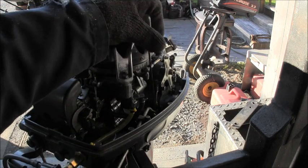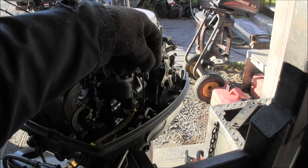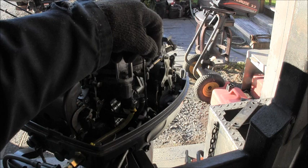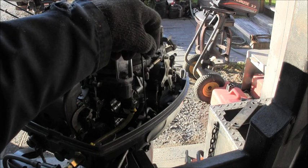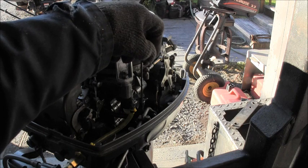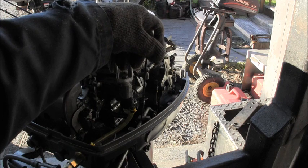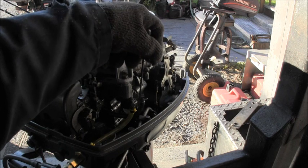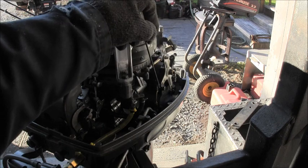And this would be easy to make out of just drilling a hole in the bottom of the pan and putting like a piece of copper pipe spacer or an aluminum spacer or even stacked nuts. And then you could easily make this out of a piece of cutting board, that white cutting board material. You could easily drill a hole and then saw through it. That would be easy to make. Then it comes down here and it just bends at a 90, has a flat with a hole in it.